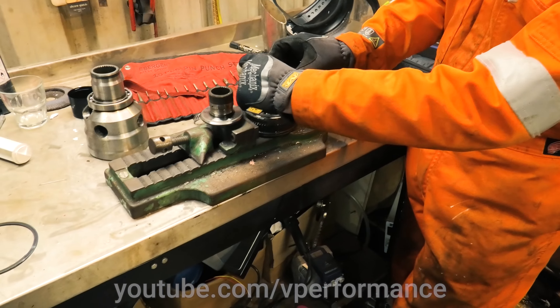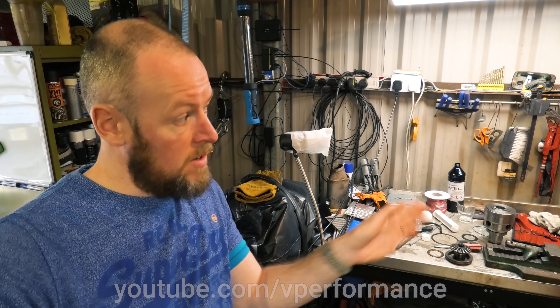The magic of doing it this way is that you don't have to pop out the front drive shafts. We've picked a difficult car to try and drift, that much we've been told. Normally if you want to convert a Subaru to rear wheel drive, you have to weld up the rear diff, pop out the front drive shafts, and weld up the center diff. But by gutting the center diff — welding up the inside and then welding up the top plate — you can leave the front drive shafts in place.